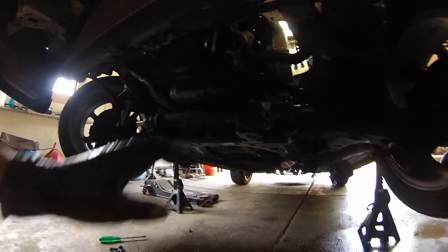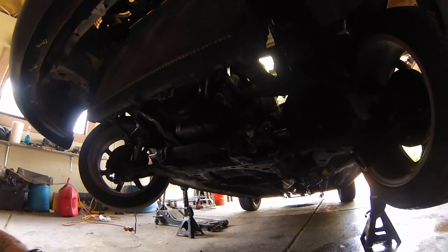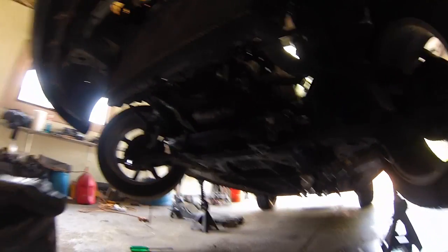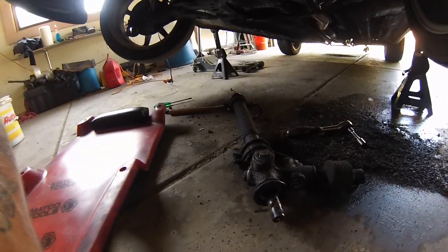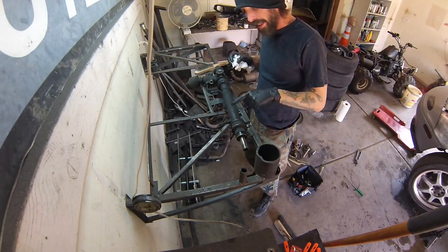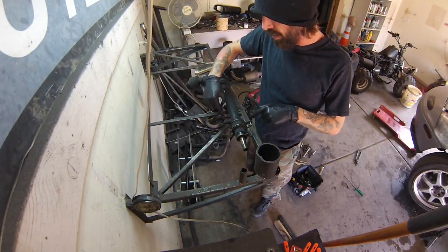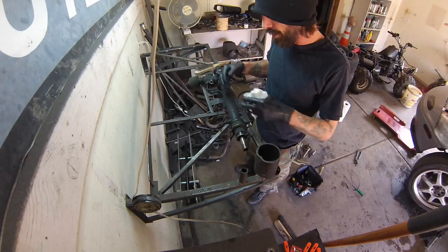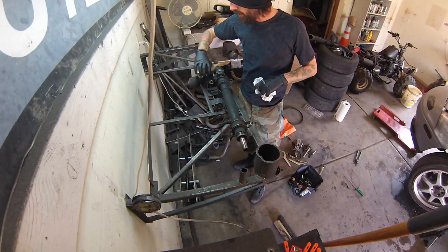I just got to do the other side, then take the four 14 millimeter bolts out and pull the rack out. They were indeed 14s — I got those out and now I can wiggle the entire rack. Also if you're ever doing a rack and pinion replacement, these are obviously the same steps, then just reverse the removal for the install. I'm going to try and wiggle this out — it should just slide right off the drive shaft for the steering wheel. That was pretty easy. Now that I have the rack out I'm going to degrease it down some more, take it to the workbench, and start disassembly. I have to take out these lines — I'm going to weld the bungs that go in there, initially cut the hoses off, and then put a little weld inside the actual head bungs to plug those back up. It's not necessary but it keeps dirt and debris from getting inside the rack.